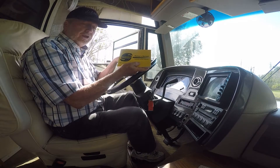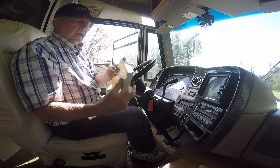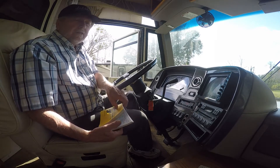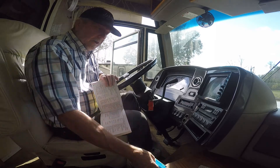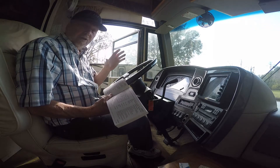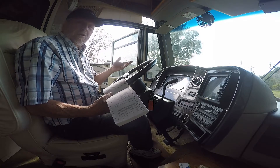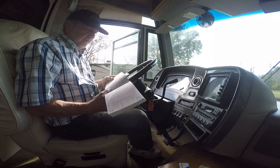This is a Workhorse chassis — yours may be another one, but it'll have an owner's manual, and I have mine marked for the fuses. You want to find the fuse panels. Get some help if you can't find out where they're located ahead of time, and look so that if you ever lose your lights on the road due to a wire coming loose or something, you want to be able to correct it right away and have some spare fuses along with you of the type you need.